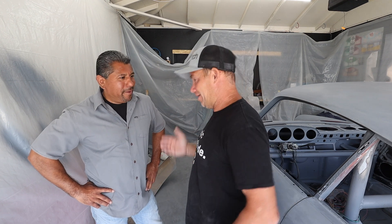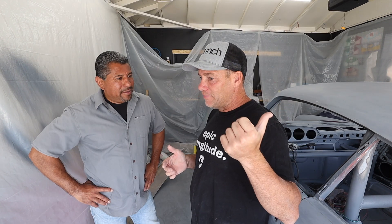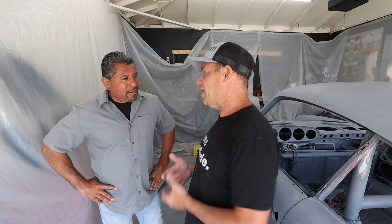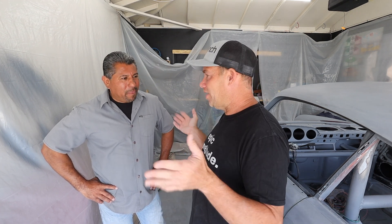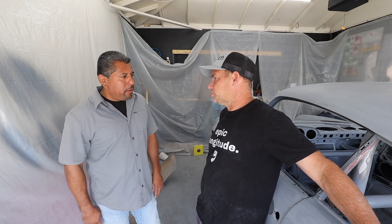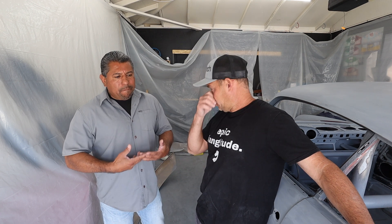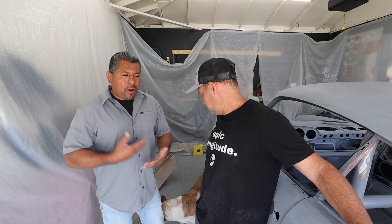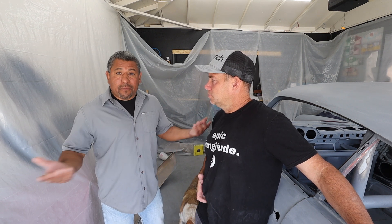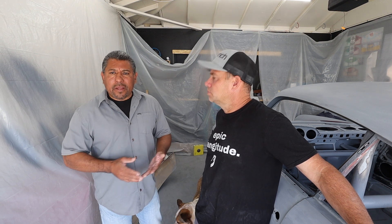You could easily throw your car on a transport in the condition we've brought ours up to and Henry's all about it. That beautiful green 911 we did for Brad has shown up at Malibu Cars and Coffee and gotten tons of attention — it's this killer Viper green car. As for painting a car on your own, there's no reason not to, especially with modern products. Two-stage systems with clear coats are really forgiving. Back in the day with single-stage, if you got a run in a metallic it was hard to fix. Nowadays the clear coats are so high quality — you can shave it, sand it, and buff it out pretty nice.